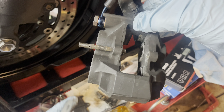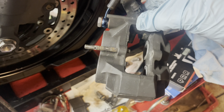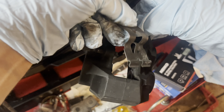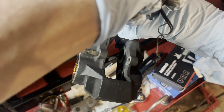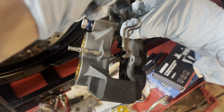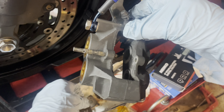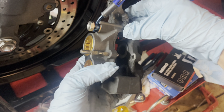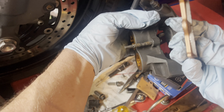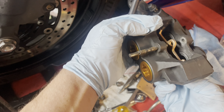Now basically you'll just get the other pads and push them through, put your cotter pins back in. When you have the bracket, you have to push through the center of there — you can see how it has that hole. That's where the rod goes through the center. You've got to line it all up. I'm going to get this one with the pad facing like this — obviously it's going to go towards this side — and get it onto that loop.